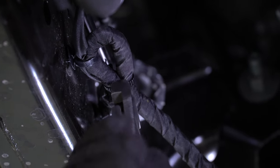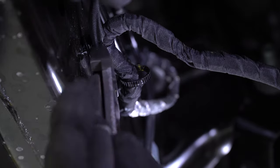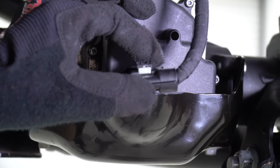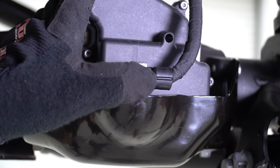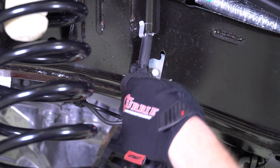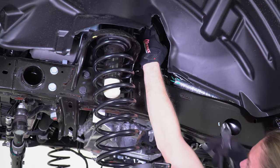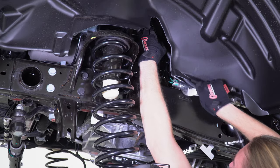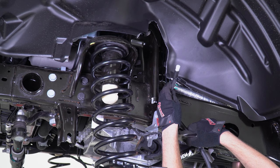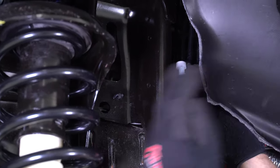Find the origin of the differential housing wiring harness at the frame. Snip the zip tie and release the full length of the wires, then plug the harness back in at the differential. On the driver side, disconnect all vent hose mounting clips on the frame. This will allow you to pull the hose down so that the upper factory plastic push connector will clip back into a new existing hole, giving the vent hose more slack. Don't forget to push the hose back into the metal retaining clip.